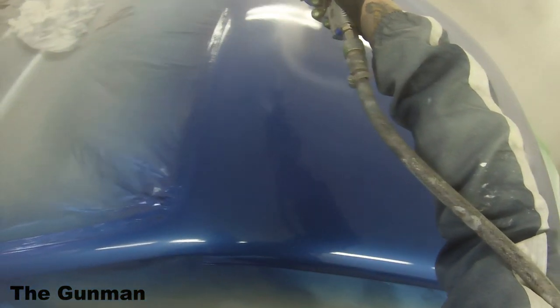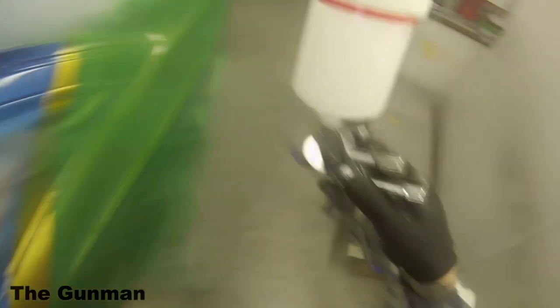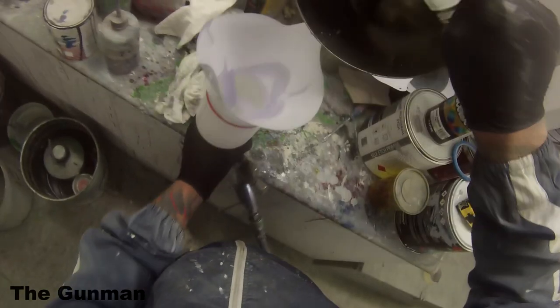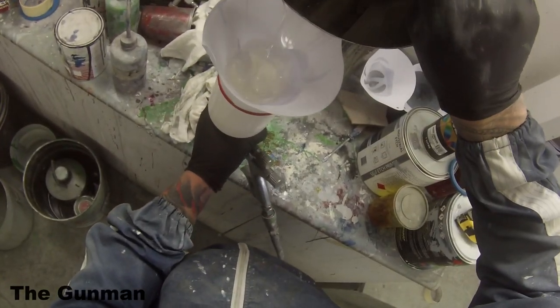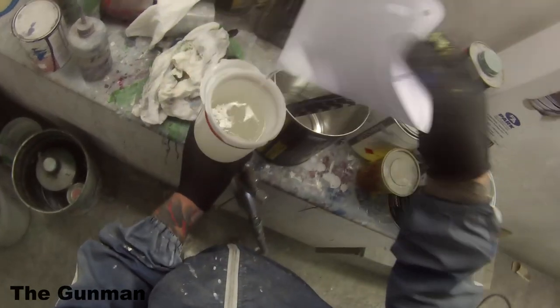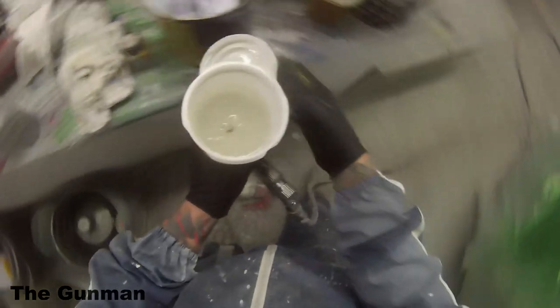And then on the last coat, sometimes I'll put a dash more thinners in it, because I've found if you have your base coat too thick, well then it'll go very chunky and you won't actually get the nice metallic effect at the end. Okay, so next question here is, what is the proper amount of clear to paint an Integra, and how much hardener do you recommend?